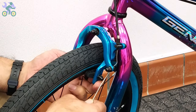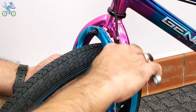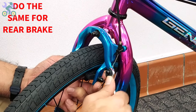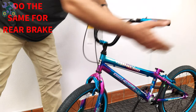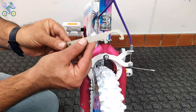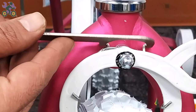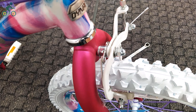To adjust the tension of the brake cable, press both brake arms with two fingers and loosen the anchor nut. Pull the brake cable and then tighten the brake anchor nut. If both brake arms do not move together and you want to adjust them, you'll need a special tool or a narrow 14mm spanner. Put the special wrench inside the two spring rings behind the brake arms and turn it in the direction that the arm doesn't move so that both arms move together. Do this several times until both arms move together.